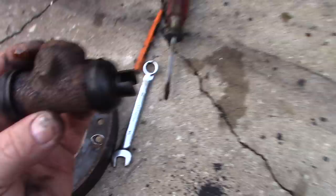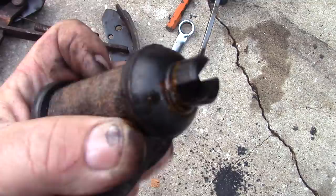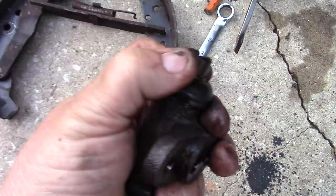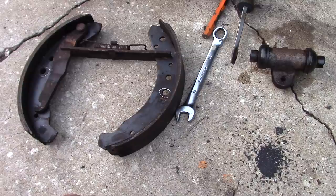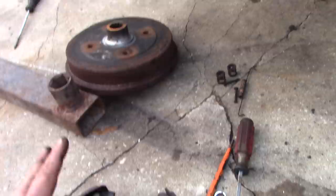These are no-name cylinders with no identification markings. They're fairly new and you can see the fluid is already coming out of the boot. If you peel the boot back, it's already bypassing fluid past the rubber out of the piston. I don't think that would have happened with a better quality wheel cylinder. That's why I always try to get the Varga or a German cylinder — you don't want the cheapest one because a lot of times it won't last the life of the brake shoes.